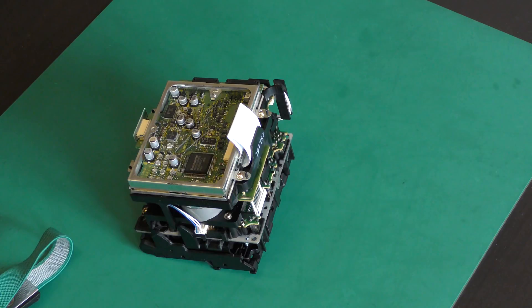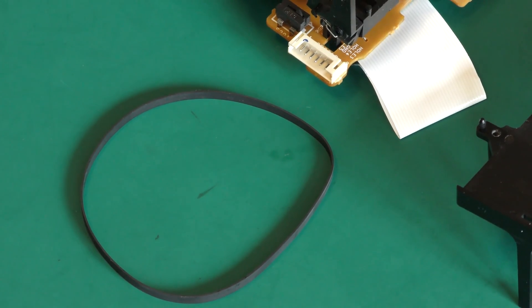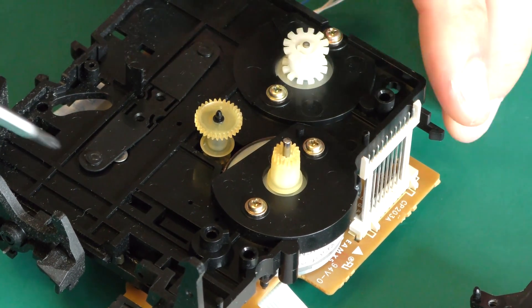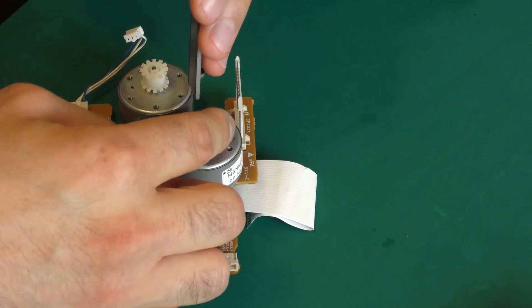The AR-1 mechanism is the most advanced used in all DCC players, but also the most complicated, because in our opinion it was not built to last. Common issues are leaking capacitors and worn belts and pinch rollers. But the biggest issue is the soft plastic tooth wheel used on the motor that was common in the 90's to try and soften the noise from this mechanism. It will simply not last and break.